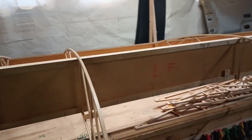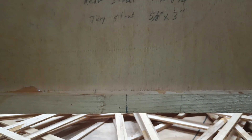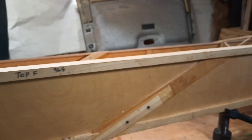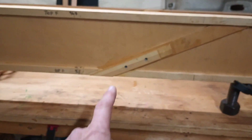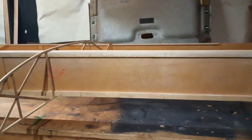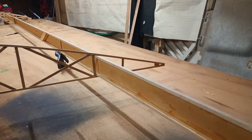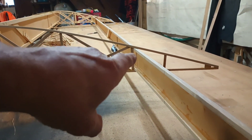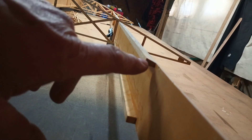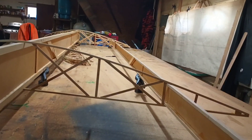Slide my ribs across — of course you've got to remove all your hardware. Then you put a straight edge line across it and measure a foot each side. You can see my spar cut into my spar, and you can't really slide the ribs over your strut attach point very well, not if you've made your ribs rather tight. So you slide five of them on from the end of the wing and nine of them on from the root end. What I like is that it's really snug — a real tight fit on the backside. I cut mine at an angle so instead of a square cut I've got the taper of the airfoil on there, so it slides over snug but you don't have to shim it.